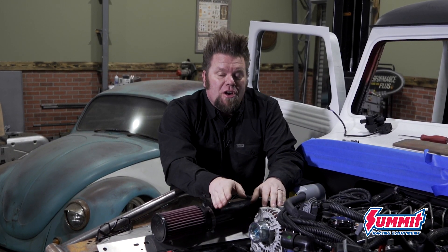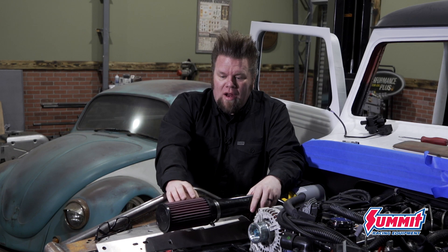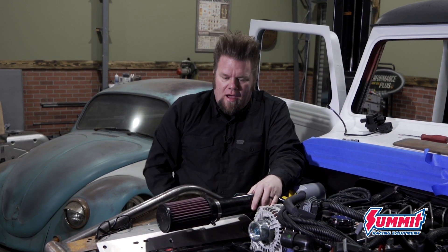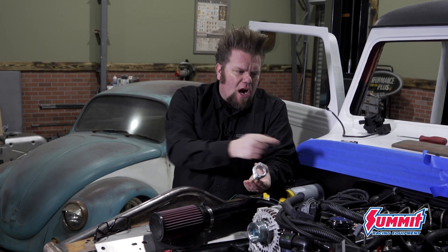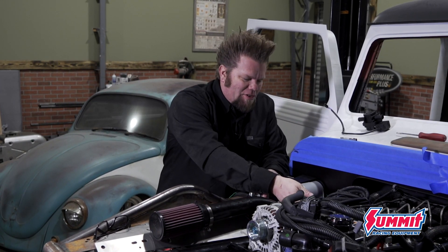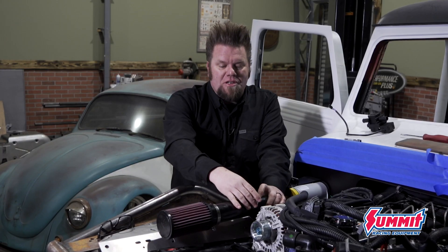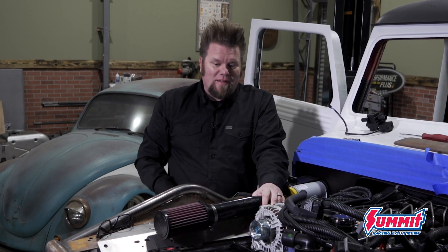The intercooler will just ensure that we are good and efficient. I'm not 100% sold on the size of this air filter — it is a little small. I did check on the flow rate for it and it should be enough to support this engine, but when I make the mount for it I'm gonna make the standoff big enough that if I want to in the future I can go to a bigger air filter. One thing I have to do right now is add the mass air meter. The R2.8 comes with the actual mass air meter as well as a pipe with a bung already welded in it, but that pipe was giant — it was three inches around and the air inlet for the turbo is two and a half. So I went ahead and chopped it off and I am going to weld it onto this piece of pipe right here. You do need to make sure that when you install it, it's in a vertical orientation — the instructions for the engine will tell you all that.